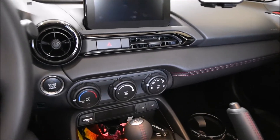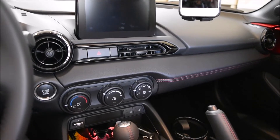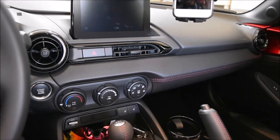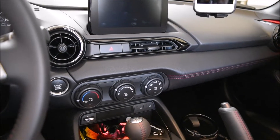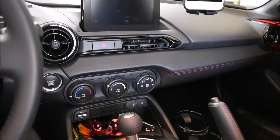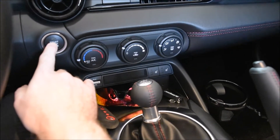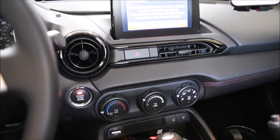So we're in the car and you're going to want to make sure you take out your navigation SD card, disconnect any devices — your USBs, your auxiliary, unplugged mobile phones, that type of thing. Bluetooth shouldn't be an issue, just things that are plugged in. Without pressing any pedals, we're going to hit the start-stop engine button — again, no pedals. That's going to put it in accessory mode.